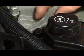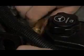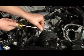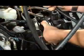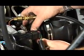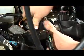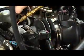When attaching the fitting, ensure that you have easy access to not overspill fuel product onto a hot engine. Disconnect the throttle body air intake, insert the S tool, reattach the throttle body air intake, being sure to tighten the clamp and reattach all fittings.